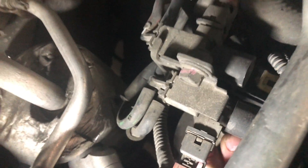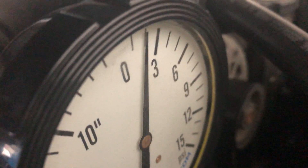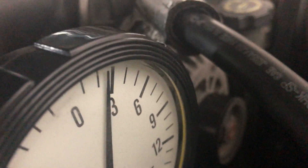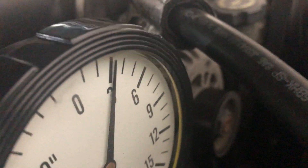So I'm going to prime this and move this out to the gauge, and I'm building up pressure. The idea is I'm going to have to fill up the whole fuel filter with fuel, and once it stays full, then I'm going to be able to start the truck. What I used to do was prime it, start it up, prime it, go back and start it, or have somebody pumping the prime to keep it running.